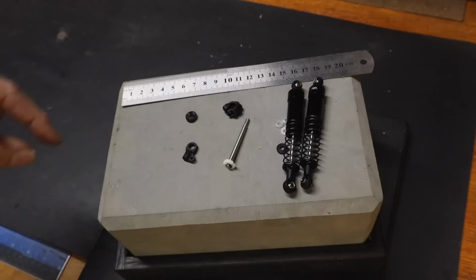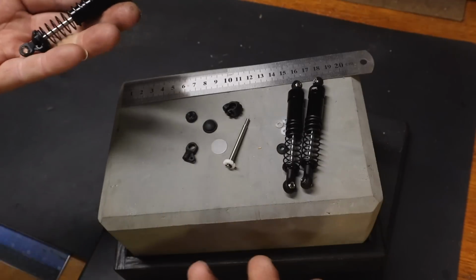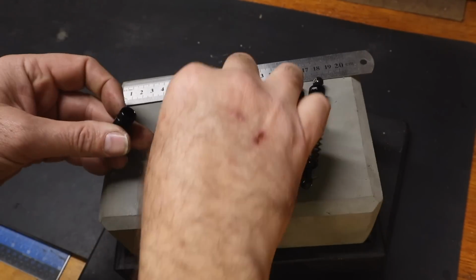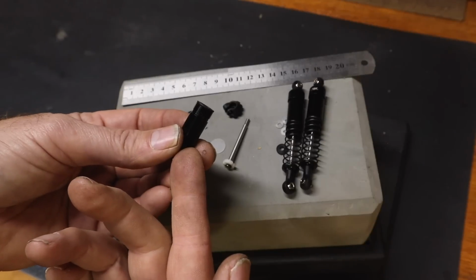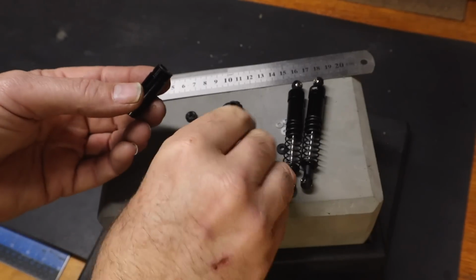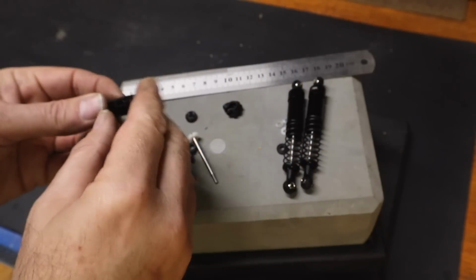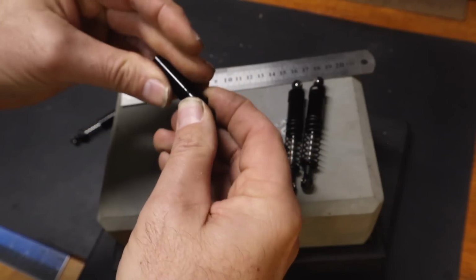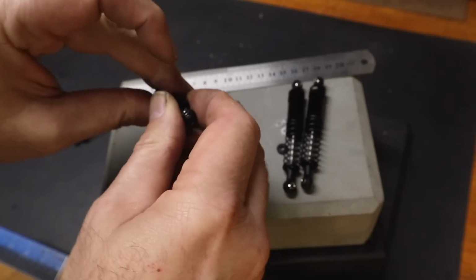There is a Traxxas bladder in there. We took the non-bladder out and replaced it with a bladder and built it like we would a Big Bore. So, you fill the body with oil, you put the bladder in, and of course, because it's a 10.2 millimeter bore, they seat in perfectly. You put some pressure on the top of the bladder, you cycle the shock down halfway, it sucks the bladder in, and then you crank the cap down on top of it, and the cap fits right over the Traxxas bladders. It honestly felt a lot like building a Big Bore.